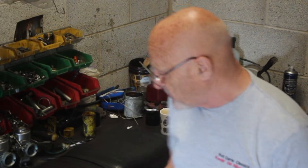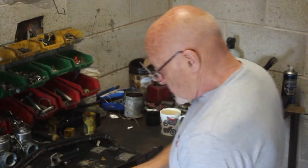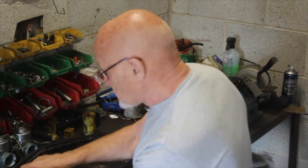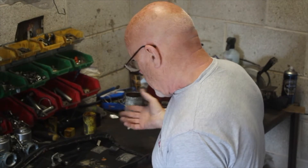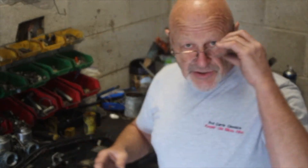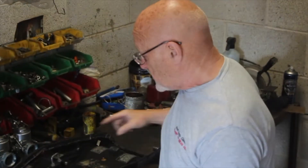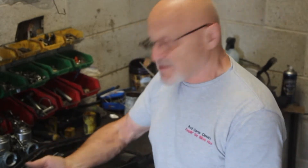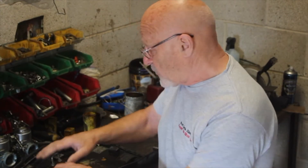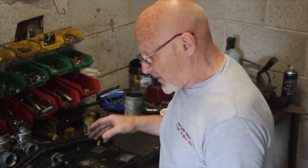It's going to look really nice when it's on the bike and it'll fit perfectly. These are done by — I'll just cut this off with a modelling knife — and then you bend all these little tangs back and simply stretch the seat cover over it. Other seats are done by gluing, and the only thing to be careful about there is if you spray the seat first and use impact adhesive like Evo-Stik, it actually attacks the paint and takes it off. So paint it afterwards. But this one doesn't need that — we'll just cut it off now and bend all the tangs back to start stretching the seat cover over.